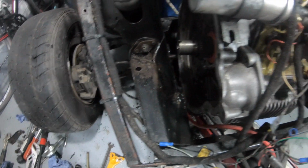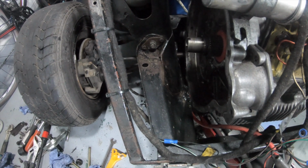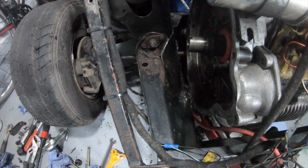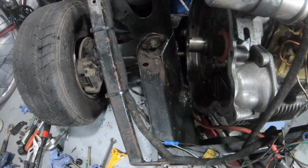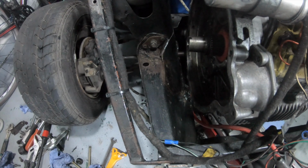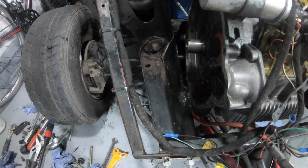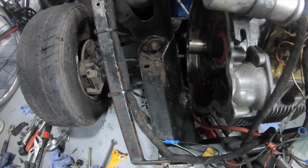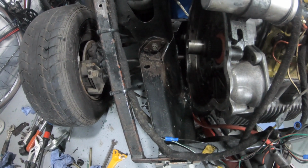I think that's enough mess made for one day. I've given it a good scrub with some soapy water, and then cleaned it off with brake cleaner. I think I've got rid of just about all of the brake fluid residue. A bit of surface rust there. I've knocked off anything loose, so I just need to find my tin of black Hammerite and touch that up.